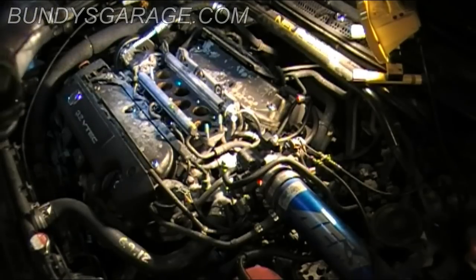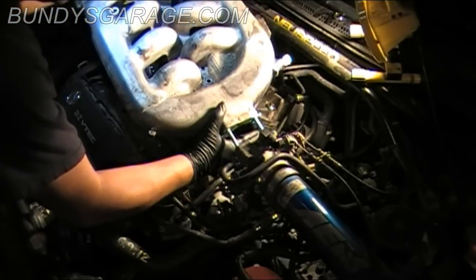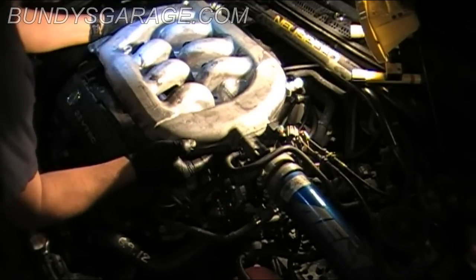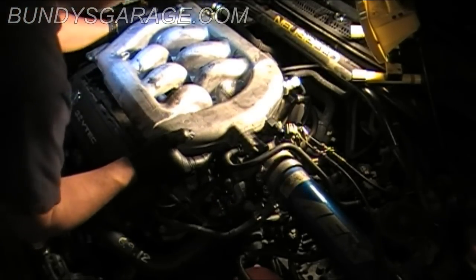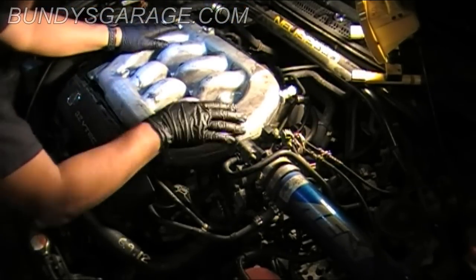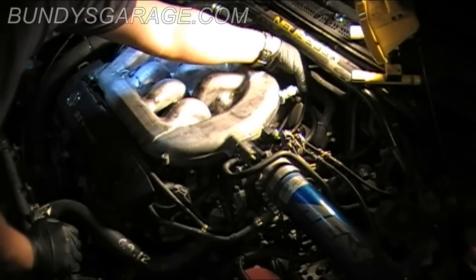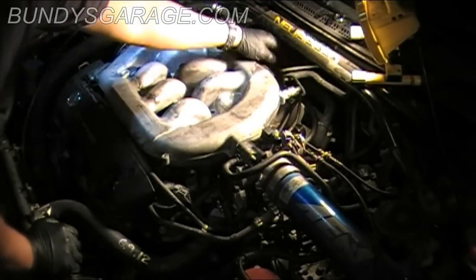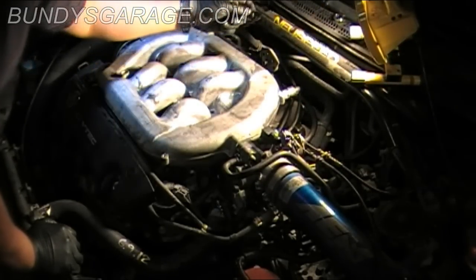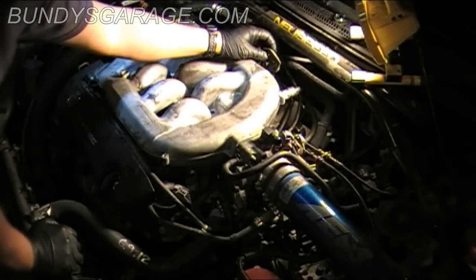Okay, kind of the same way we took it out, I should say, that's how we're going to bring it in. I'm going to start by here, lead the studs into the throttle body. Those glide in, and then make sure that's secure. And I kind of eyeball your bolts here, and it sits back in. Okay, cool. That connector in, and make sure you bring your gasket in here on this side. There's actually only one way that this will go, so go ahead and do that.